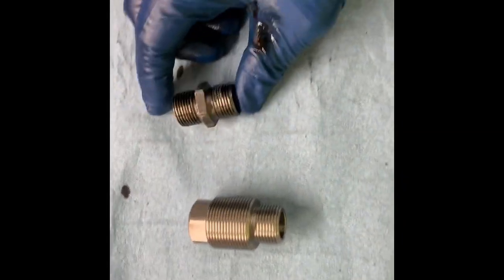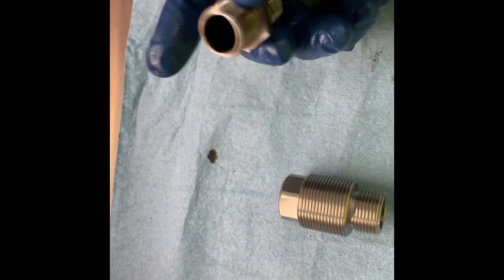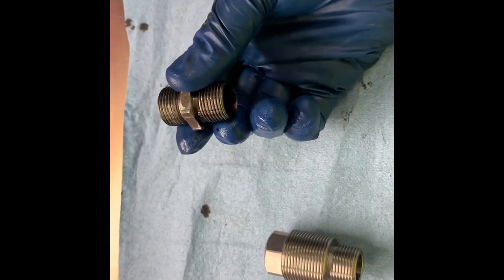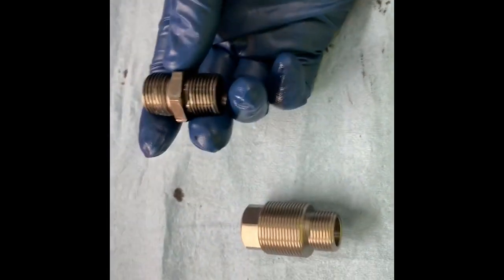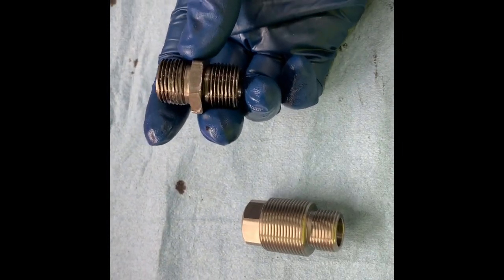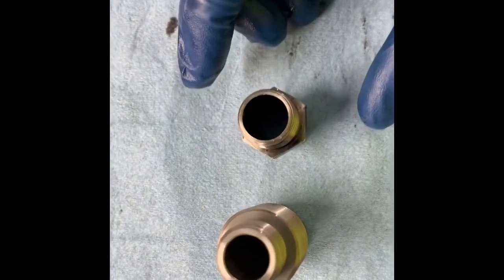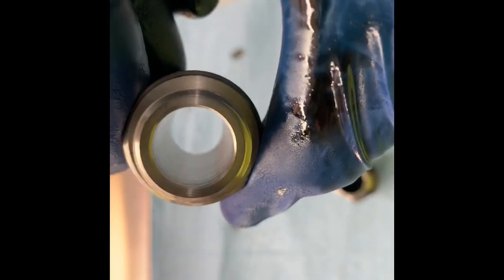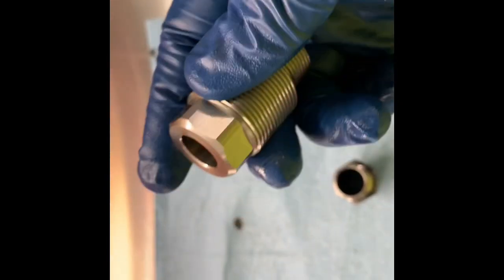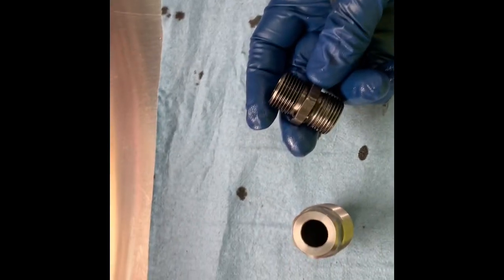Here's the factory thread adapter for the oil filter. It's a 15/16ths deep well. All I did was slip it on and untorque it — this end was facing the engine block. It does have quite a bit of thread so you'll have to work with it for a little while; it was not very tight, just be patient and it'll come right out. Here's a size comparison to the MDDP adapter. I checked inside it to make sure there's no leftover metal debris from the manufacturing process — I know it sounds overkill but you can never be too safe.